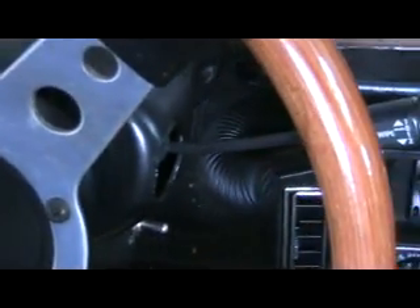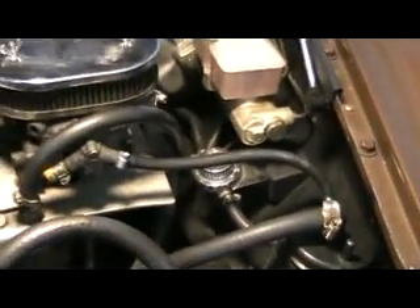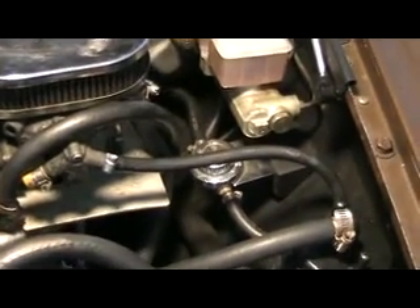Either way. What that does is it shuts off the fuel pump completely. With that fuel pump switch tripped, the fuel pump isn't perking, it isn't pumping. So when you're inside the engine compartment checking out electrical circuitry — maybe popping fuses out, fixing wires, or just having tools bang into things — it's so easy to have one little spark go off. You really don't want any fuel smell, odor, or dripping. It's just not a good idea. So the switch is great. Besides being a good deterrent for someone else starting the car — obviously they aren't getting gas, they aren't going to start that car and go anywhere. So the two of those go in tandem, and I would suggest putting the switch on to control the fuel pump itself. And I really suggest putting on this fuel pressure regulator to protect the amount of pressure you're feeding into your carburetor so you don't get excess fuel or excess spillage.